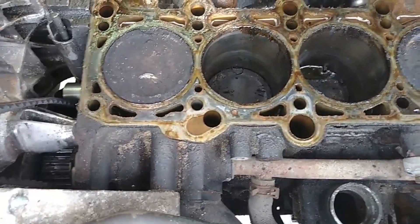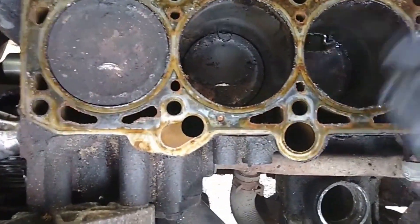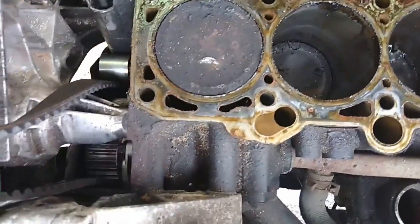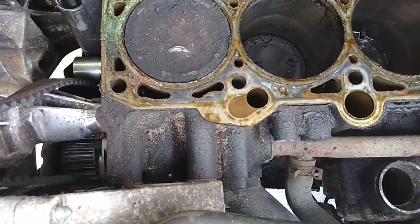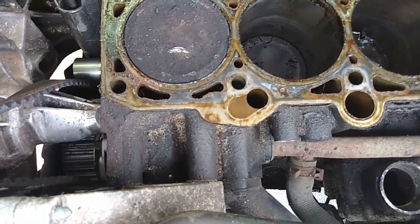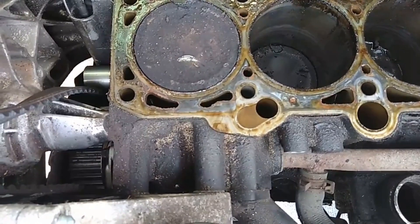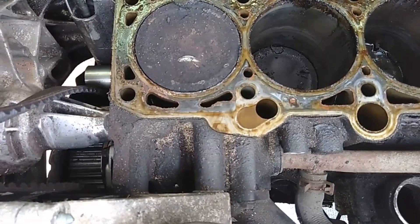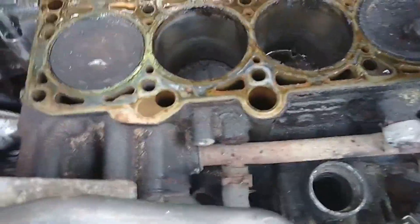So that's just to start. For today I'm gonna see if I can go ahead and get Tony back together. I'm gonna clean up the mating surfaces and clean up the pistons a little bit. I don't know if I'm gonna worry too much about this right here. I think I was wrong too — that right there looks like one of the intake valves hit instead of the exhaust.